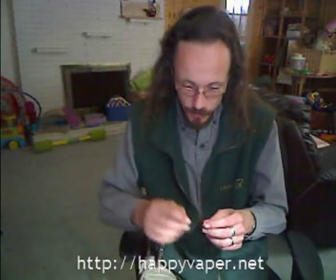not work on the Colibri is that the white cap is different. You can see there is a little tube sticking out in the middle that goes into the tube inside the cartomizer that the fabric with the e-juice is wrapped around. So there is really nothing for the screwdriver to catch onto, so you have to find something else. It's very difficult to pick at it at the edges of the white cap, so screwing something in is pretty much the only way you're going to get at it.